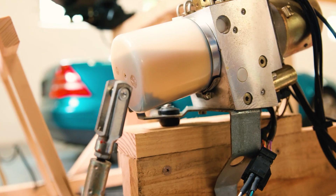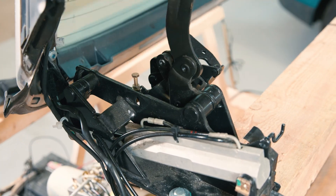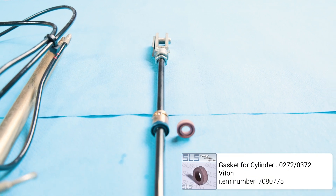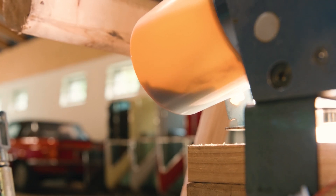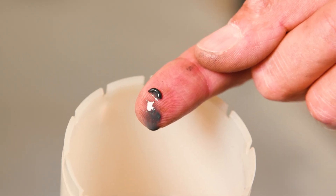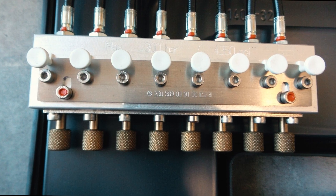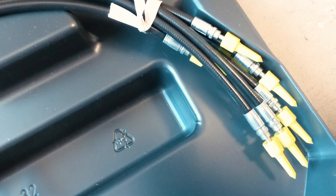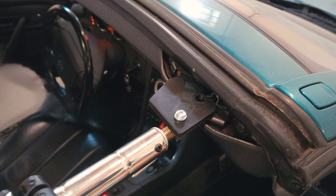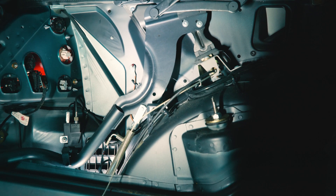Although the metal roof could be considered an upgrade compared to older SL models, it is extremely rational in the R170. The pump operates the 10 lines to the five cylinders with only two solenoid valves. All mechanical follow-up movements are guided by cables and levers. The pump has an oil reservoir with a filter screen and fill level markings. Approved oils are ZHM oils according to operating fluid specification 340.3. In this video we will not cover cylinder repairs, electronic details, or diagnosing deterioration of the pump — we strongly recommend visiting a specialized workshop.